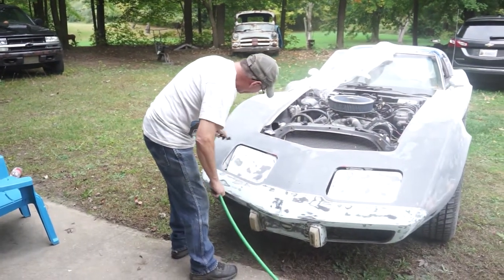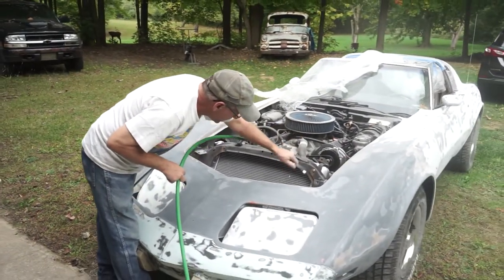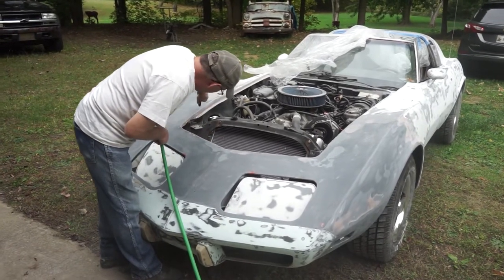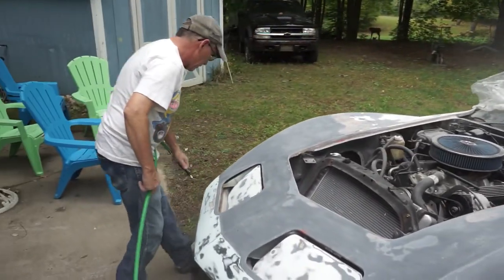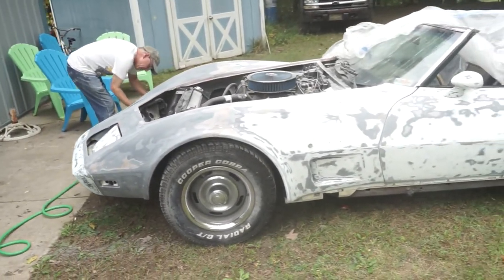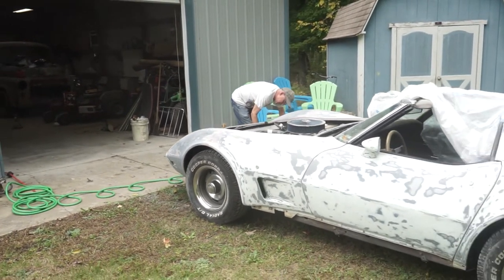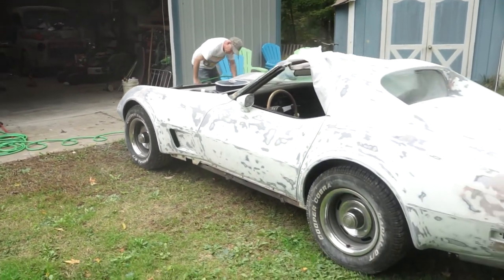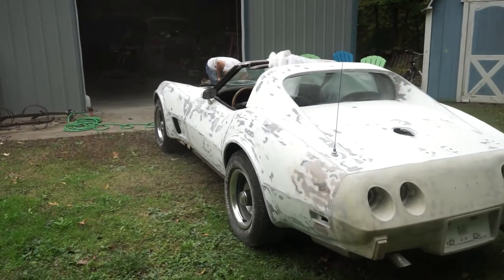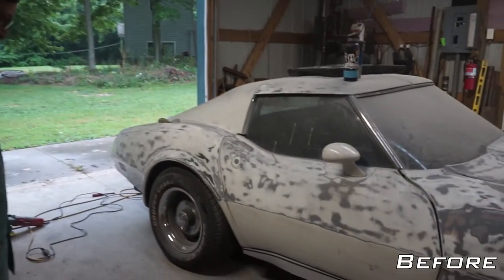Testing. Hello. Is this thing on? Oh, hey, this is Devin from the future. Just stopping by to say, for some reason, I had lost a lot of the footage of sanding the car for the finish sand with 220 grit sandpaper. Basically, you just want to get it so that the 80 grit scratches are smooth, and all of those little lines and scratches kind of fade away, and it just becomes a smoother blotchiness.